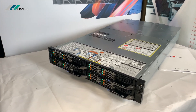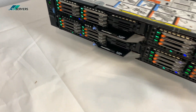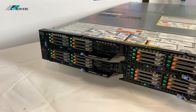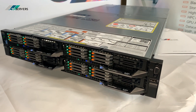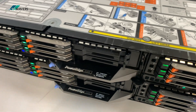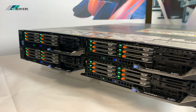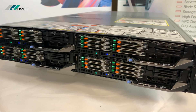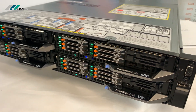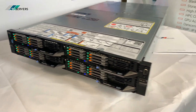Welcome to today's video. We're having a look at this amazing server — the Dell FX2S 2U blade system. It's a quad node server with four FC630 blades installed, which is equivalent to four R630s or four R730s. We have this in the special 1.8-inch 8-bay backplane on each of the nodes. Each one of these boxes is an independent server, and there are four of these in a 2U form factor.